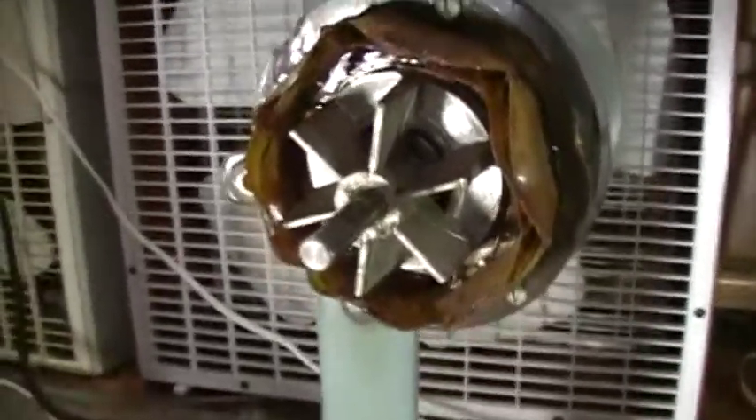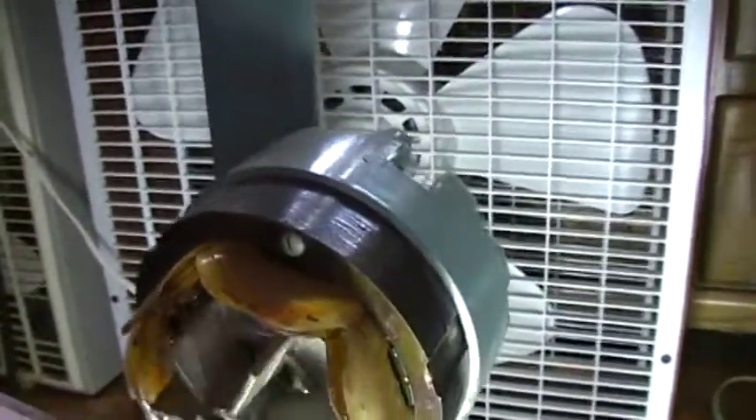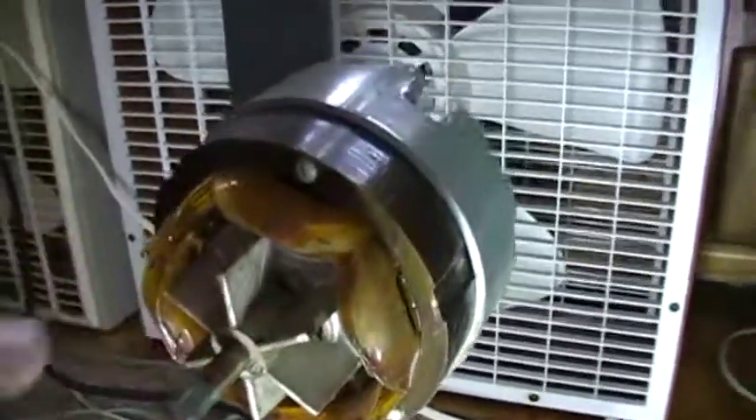Here's the front of this motor — it's just a uni-bearing, you can sort of see the bearing inside. The whole rotor and shaft assembly will come out once you remove that c-clip. You might have to sand down or file down the edge of the back of the shaft, because these do tend to stick and won't pull out properly. But that c-clip is all that's holding it in and keeping it from pulling out the front.